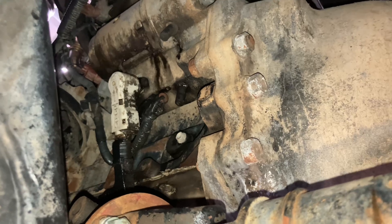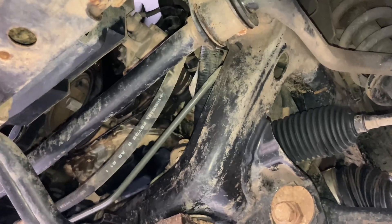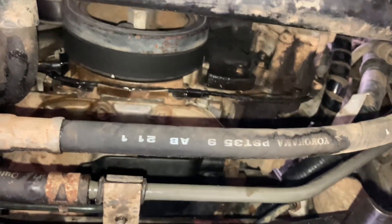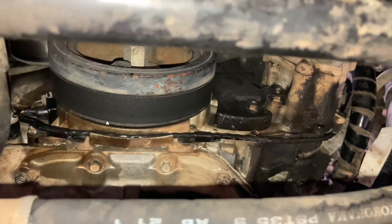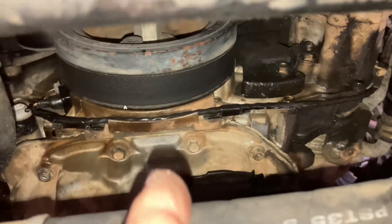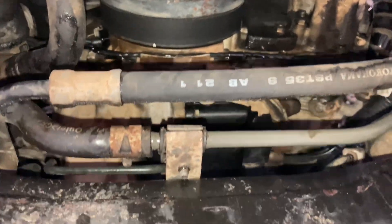Looking at the block, the transmission stains and the block stains — it looks like an original block, so it's certainly not a new motor. I don't think it's a changeover motor, because if you bought a rebuilt engine it'd be all painted up and look better than this. This has got a lot of rust on it, kind of like the rest of the vehicle. So I don't believe the engine's been changed, but the fact that it might have a head gasket leak — I'm very suspect on that from what I see, because it does look like an oil leak up there coming out from underneath the front of the head.